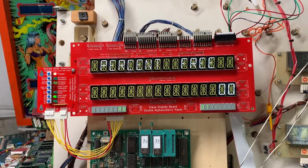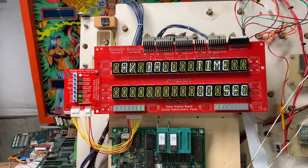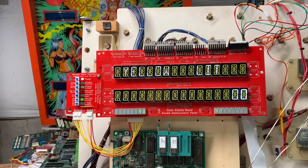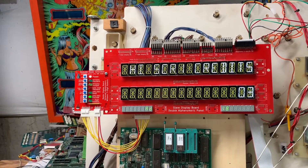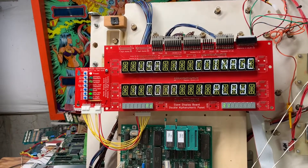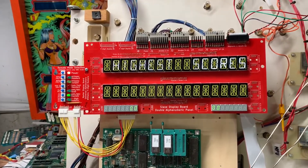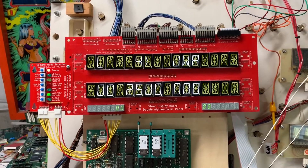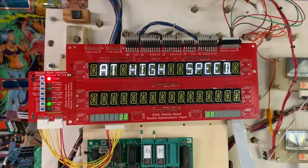Let's see if I can put it on free play — that is adjustment 23 if I have it written down correctly. There we go. Cycle through those, the board will reboot and probably say free play here in just a second. I love this new display panel that I got from Victor slash dumbass — it's in white characters and it's really sharp for doing this kind of work.